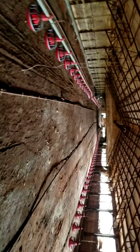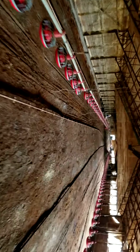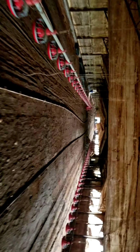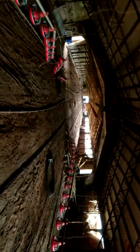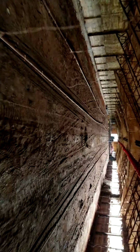From there, what we found was easiest, the very first barn that I did it with, I ended up pulling it outside, but you've got plenty of space inside these barns. So what we found was easiest was to pull it out somewhat to get the auger started coming out, and then take a chain and hook your skid steer to both sides. And so that's what's down there at the very end of that barn. We just hooked the skid steer to both of them and pulled them both out at the same time. If you do it by hand, it is possible, but it'll wear you out by the time you get done pulling 300 feet. And then you've got them out in a good straight line.